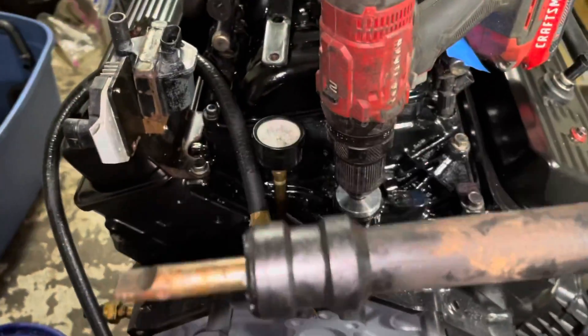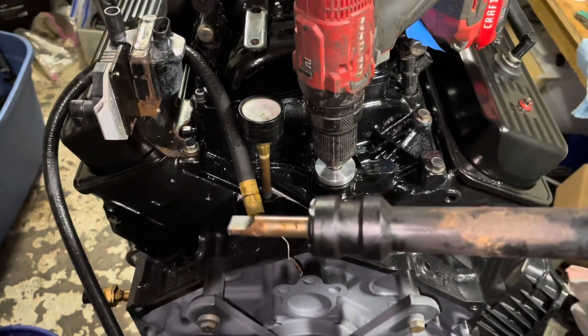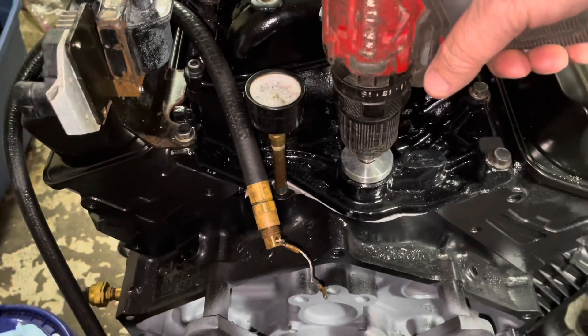The tool has this shape — you can see that shape right there. That shape is down where the distributor sits, and it's what helps to build oil pressure; it blocks off some passages down there so that you build oil pressure.